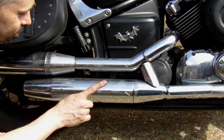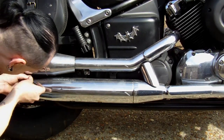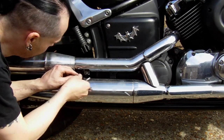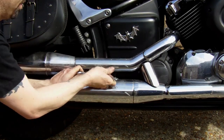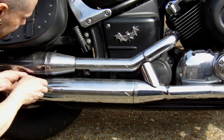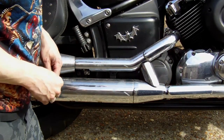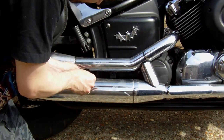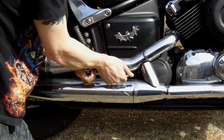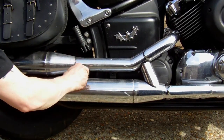This is the exhaust — we need to take the baffles off. This baffle's easy. We've got to crack a bolt just in here and in here. So this is the fun part. There we go — just undo those two. Don't take them out yet. Here's another Allen key. Same again. There we go. Just undo that — what it does is release the exhaust. Don't need to pull it out.